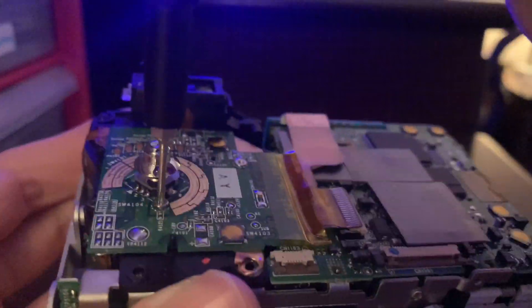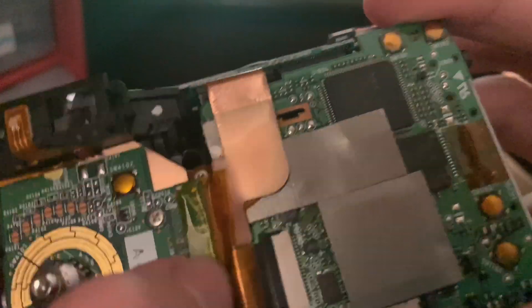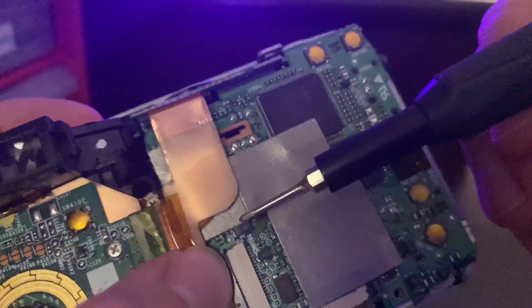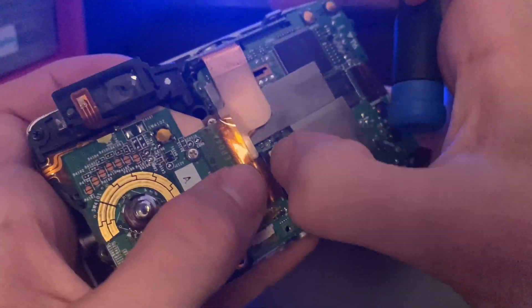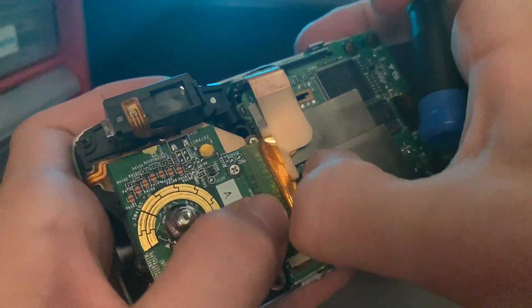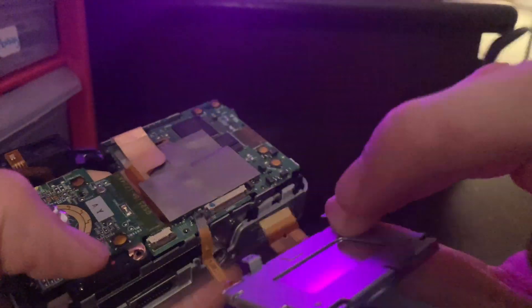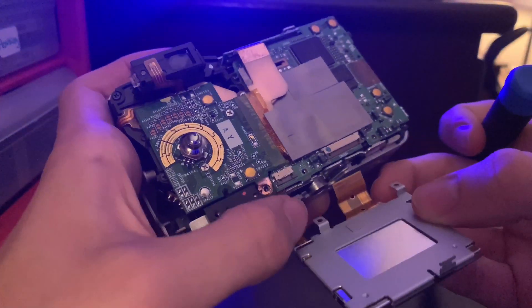I did put in the silver screws, but they're really supposed to be the black screws — that was my mistake. One thing you should do before you put down the logic board: put in the little ribbon cable into the connector first, because it'll be a lot easier to get in beforehand. Here I'm struggling a little bit to get it in because it's such a tight fit — it will be easier if you just do it before you put it down. Putting back that tape on there — I think that tape is just to cover it from accidental connections there.